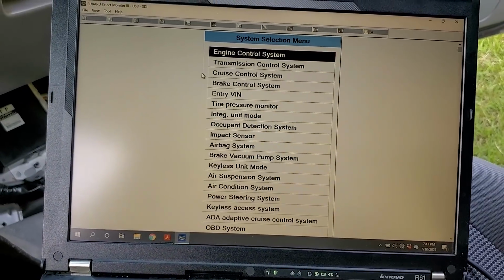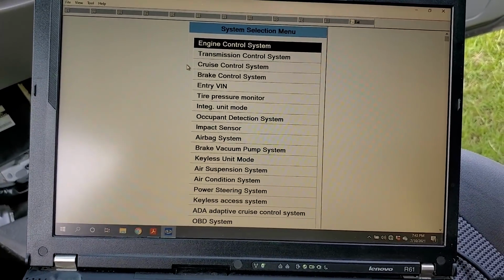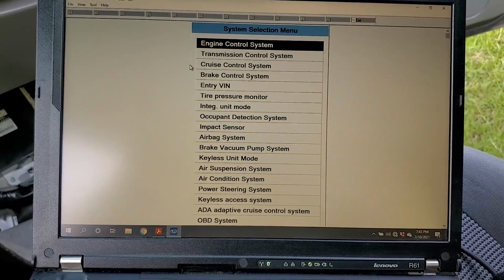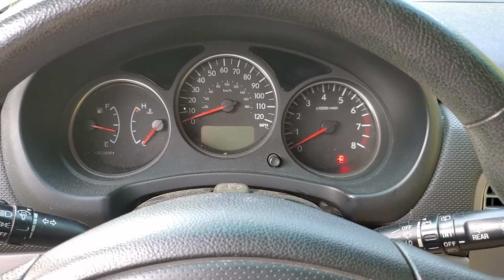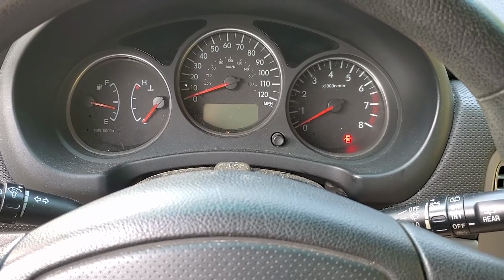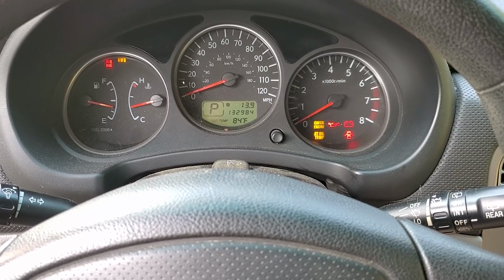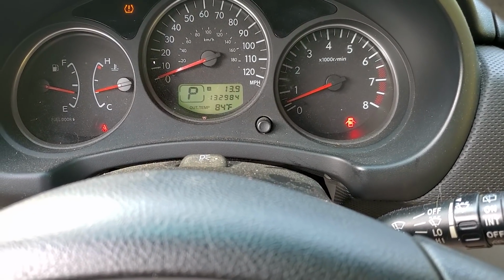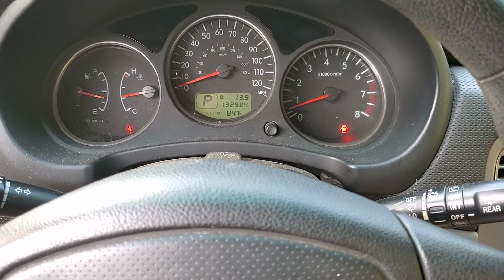And we will go through, as I said, probably clean the throttle body, take a look at it, and do an idle relearn procedure for the very low RPM on startup. So real quick, I'm gonna start it up and let you see this low RPM. The engine kind of bogs when it starts. Didn't want to start the first key on, and it kind of bogged down that start, so idle relearn should remedy that.